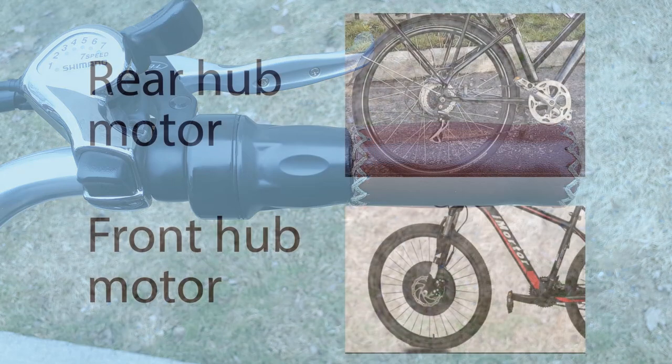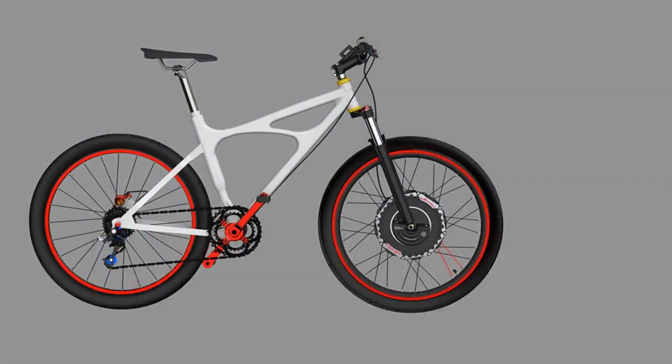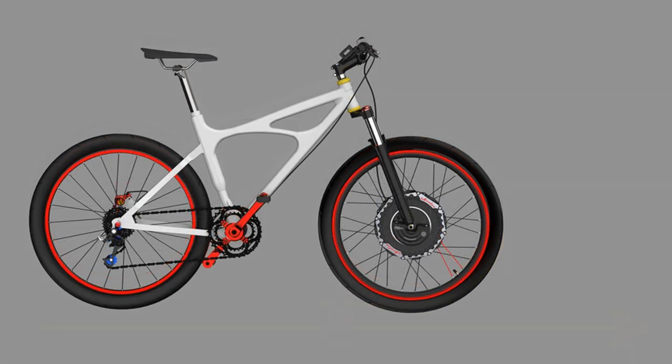If we decide on a hub drive, should it be a front-wheel drive or a rear-wheel drive? The decision will be easy if your bicycle store sells only rear-wheel hub drives, which is usually the case because they're more popular than the front-wheel version. But there are good reasons why a person might prefer front-wheel drive. The front-wheel hub drive is better on ice, snow, and loose sand, because it pulls the bike in the direction of the steering. Also, having the motor up front makes it easier to remove the wheel to fix a flat, and it leaves the rear-wheel hub free in case you want to convert your bike to a single speed bike, or you would like an internally geared hub, which I'll talk about in part four of this series.